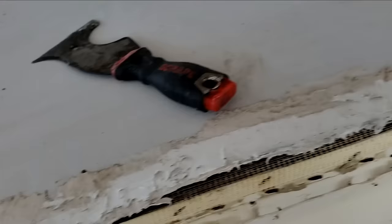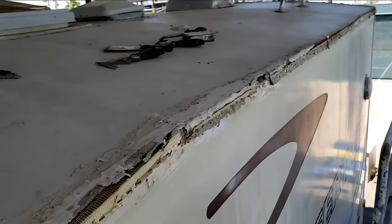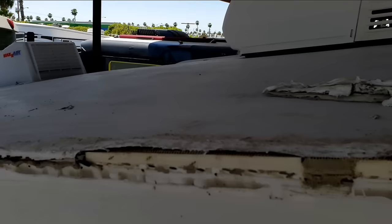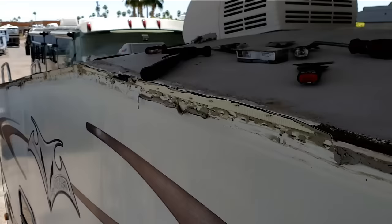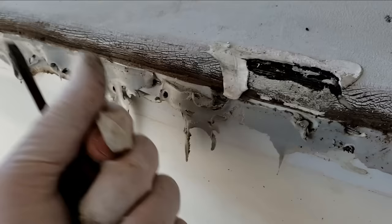I'm just going to continue on. I've still got a long ways to go. I don't think it's going to go very well if I leave all the staples in, so I'm taking out all the staples — and this is actually a lot more staples than a standard amount, so this is a little more tedious than I'd planned. On a new roof you just pound those things in, don't even bother pulling them out. But because I've got to make sure the tape sticks, I've got to get those out of the way. You can see this section from there all the way to there — that's at least six feet — it's been tearing. Maybe when they put the roof on they pulled it really tight. That's the only thing that makes sense to me the way it's tearing. So until now: don't pull things tight.